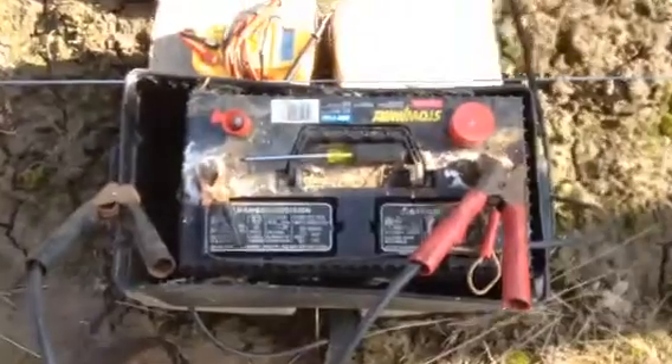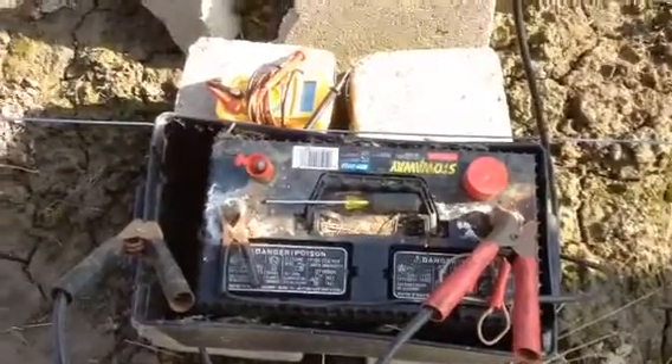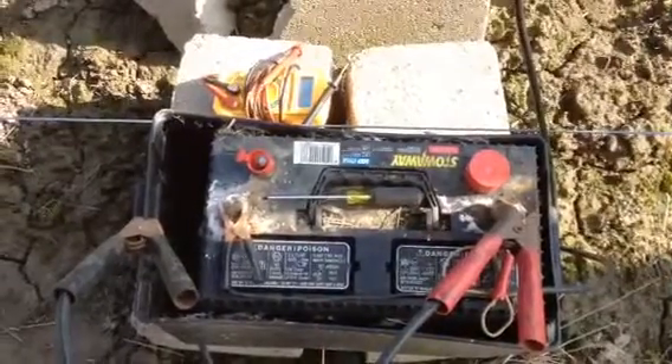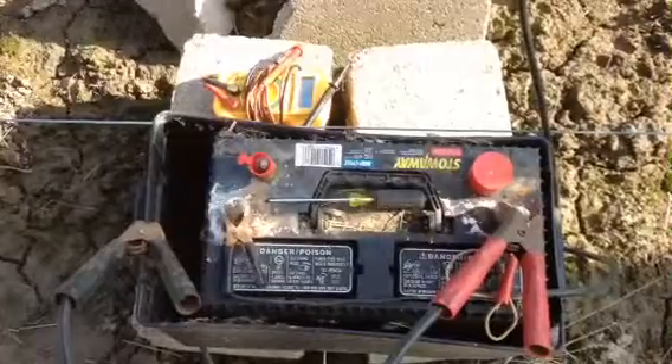I've been using Murphy to jump start the battery again, which is what you do. I'm hoping that it will pick up more charge in the next day, and then I will be adding water to the battery with some EDTA to clean the plates off.